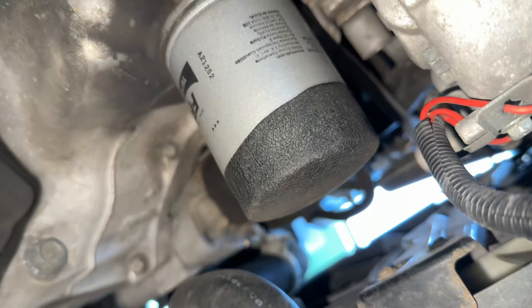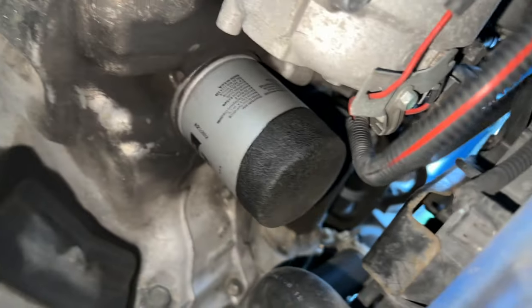At this point the car is already jacked up on jack stands and we've got the front guard already pulled back, so we have very easy access to the oil filter. You don't have to completely take it off if you're just doing an oil change — we do our oil changes every three to five thousand miles. You can pull it back, get easy access to the oil filter, and then you've got the engine oil bolt clearly marked underneath.